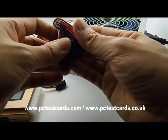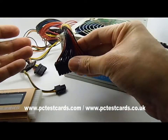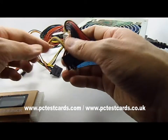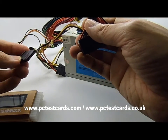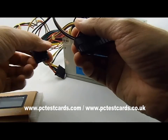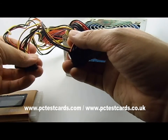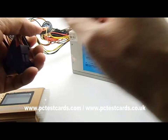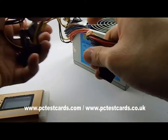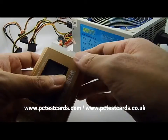The main 24-pin connector is the main power connector for the computer motherboard. There is also the 4-pin extra connector, typically near the CPU. This is the standard SATA power connector for SATA hard drives or CD-ROMs, and there are the earlier IDE 4-pin power connectors for older hard drives and CD-ROMs. Here is the main power cord.